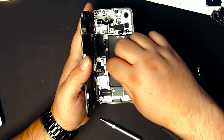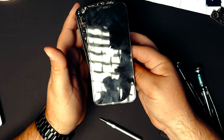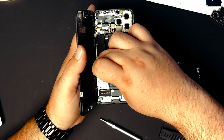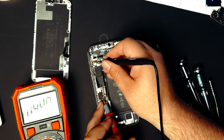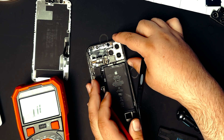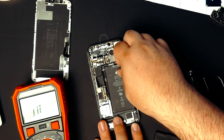Let's disconnect the proximity sensor again and turn it back on. Reconnect the battery — Apple logo — does it stay on? So far so good, still going, and we are on. I'm going to grab our multimeter and test again. We should have ground on the outside, and as we work our way in we should have 0.45, 0.38 — this should say 0.6 but it's not, it's shorted. Somehow when the phone fully drained of power it registered as fine. The value is changing — it started at 0.2, went to 0.3, now it's at 0.4 — something is happening as the energy dissipates in the board. Let's split it.